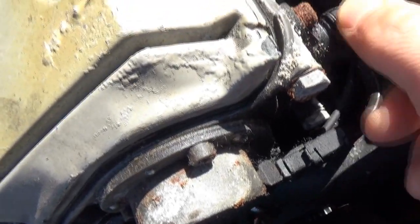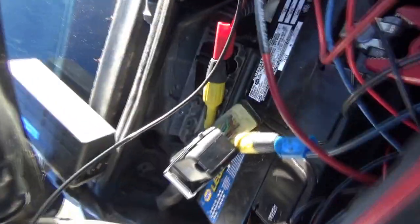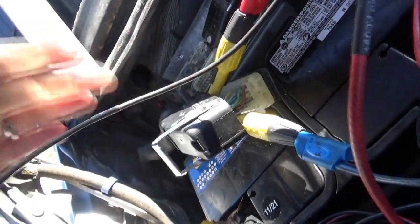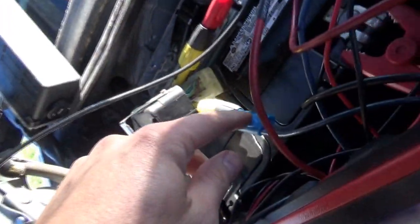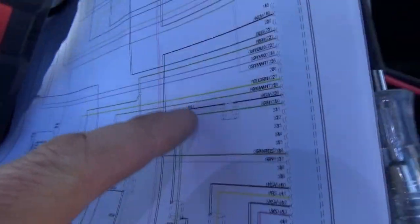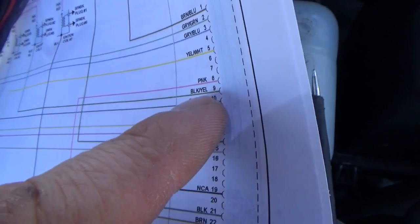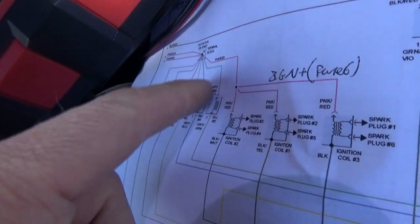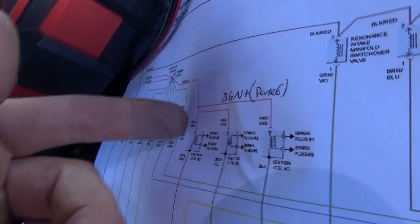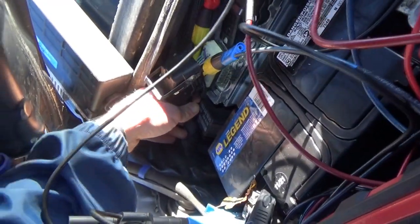These connectors are not very back-probe friendly — you have to remove the screw and pry it out, but the wires aren't long enough and everything is shrink-wrapped. I don't want to destroy the harness, but I carefully poked a couple of holes. Channel 1 is the CKP signal wire — the green one at computer pin 30. Channel 2 is the camshaft position sensor — the pink wire at pin 8. Channel 3 is on an injector.